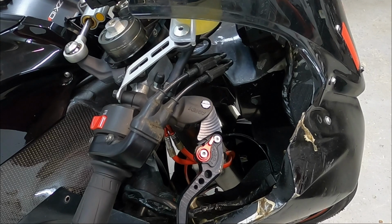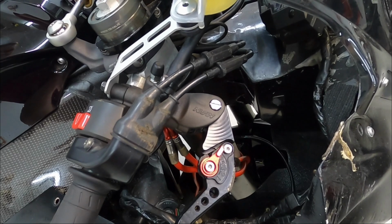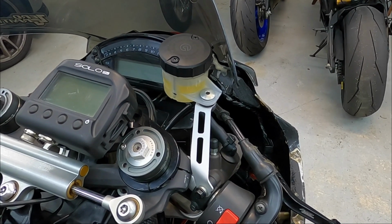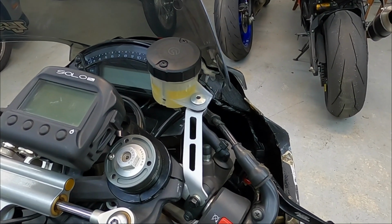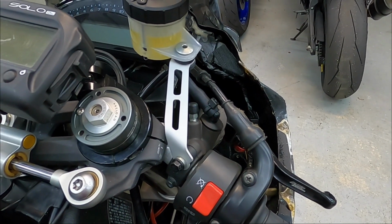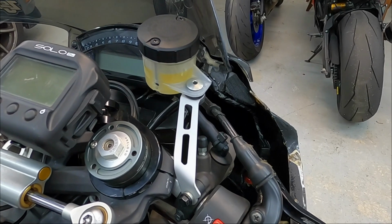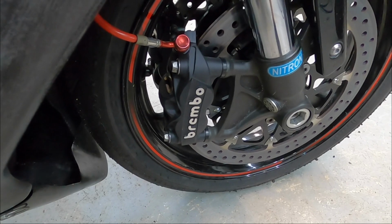The master cylinder on the GSXR1000R is 19mm. This is the OEM master. It bolts on, no problem, and fits correctly. There's a Brembo relocation bracket and reservoir. This is required because of the new mounting on the master. The way it's relocated is how I found it needs to be mounted correctly and secured. I used Vesrah SRJL XX pads.